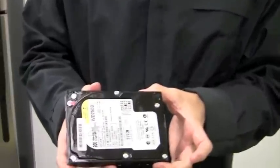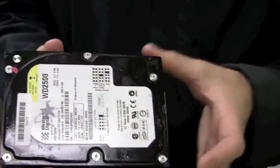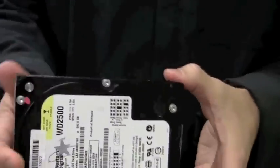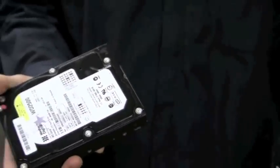As soon as you take it out of the freezer — and you can see we've had this out of the freezer for literally just a couple of minutes, maybe not even that long — the drive has already started to sweat as it comes back up to room temperature. What that means is inside the drive, the exact same thing is happening: water is condensing onto the very delicate platter surfaces. As you spin this up, the heads will actually drag through that water and can do significant damage to the platter surface.